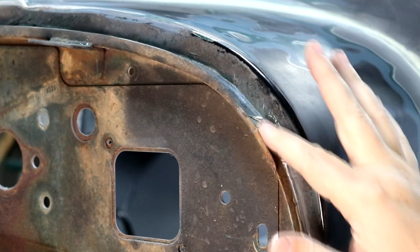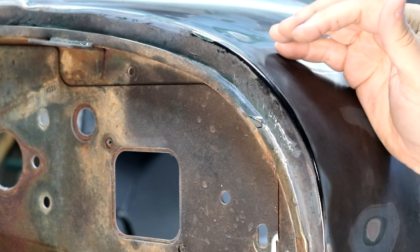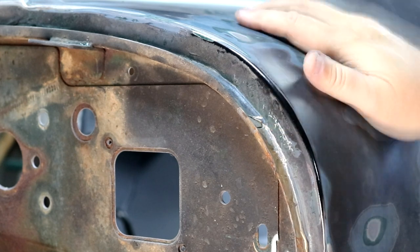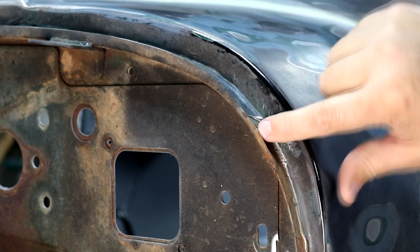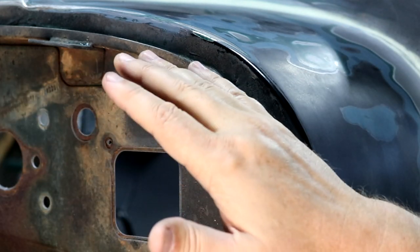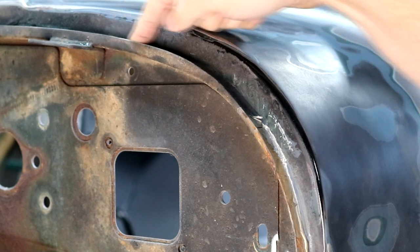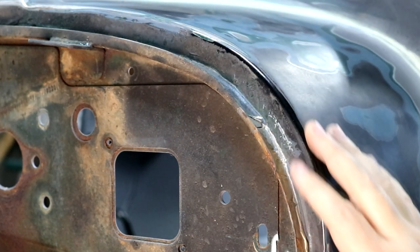And I've been removing some factory installed seam sealer in this joint, and I'm going to show you just two places on mine where the seam sealer actually got into this area, but didn't even make it over into the area where the joint was. And this is where the hood comes here and ends. So any rain that hits the hood is going to run back, fall into this joint. It's going to run through this little trough and hopefully come down this little gutter and get down to the ground.